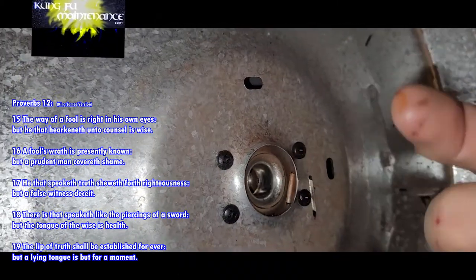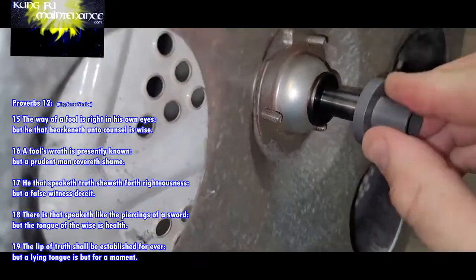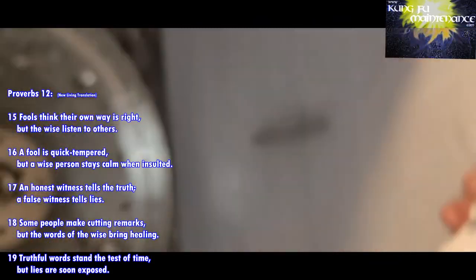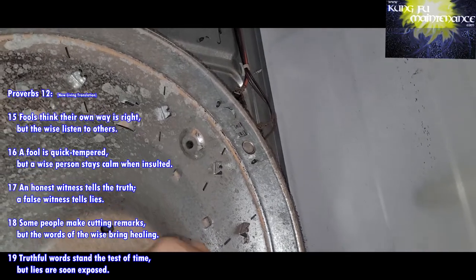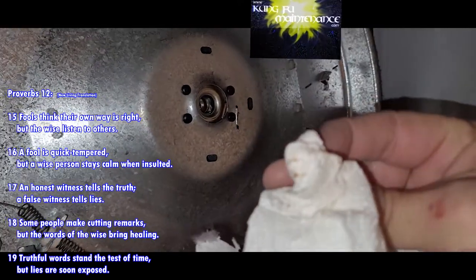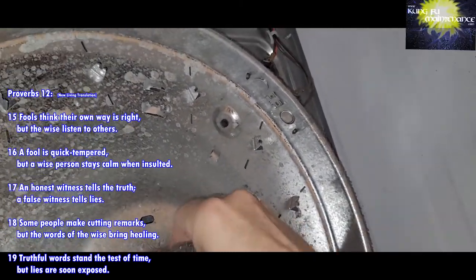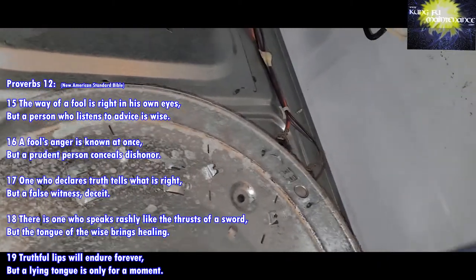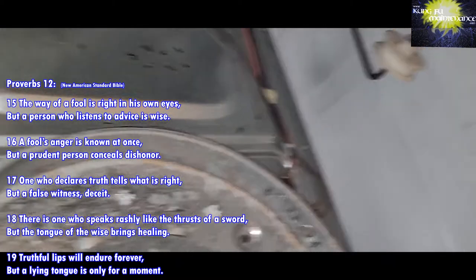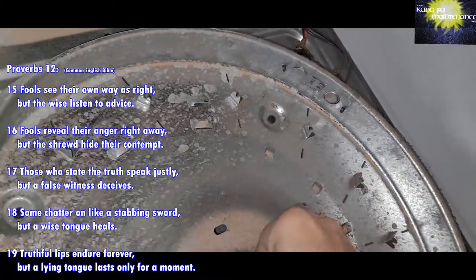Okay, so for these, my preferred method now is just using paper towels to clean off the bearing, then clean the post, and also clean this port here. In a pinch, oil can work. I've used oil before, like Zoom Spout oil, which is great stuff, but this particular one, 3 or 6 months later, actually squeaked. So what I think is better is to clean all that out and have this bearing sit dry. Just cleaning it off with a paper towel can fix it a lot of times. If you need a new one, you can replace the bearing and the O-ring. But a lot of times you can just clean it up, shine it up with a paper towel, and not use any lubricant, because it just works better that way.